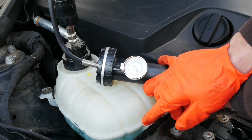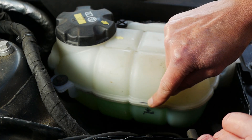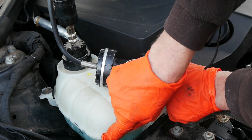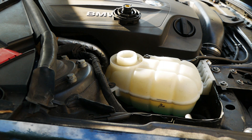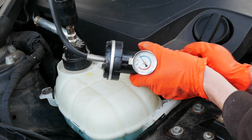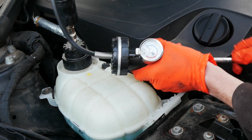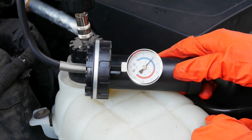If you're not sure if you have a leak on your system or not, make sure you know exactly where your coolant level is, because once you pump this up if there is a leak it'll start leaking. It's really helpful if you know where your level was because if you see that level drop, it means you have a leak on the system somewhere. I'm just going to go ahead and pump this up — it's only a little pump so you do have to go a bit. I got mine somewhere between 10 and 15 psi.